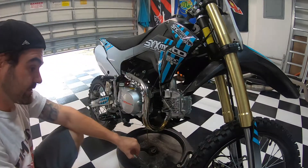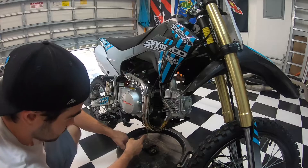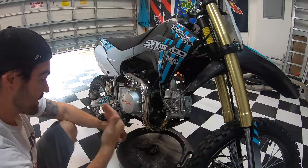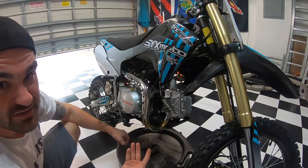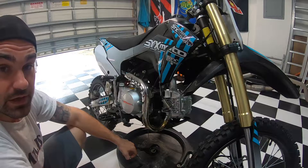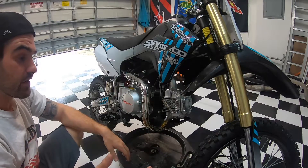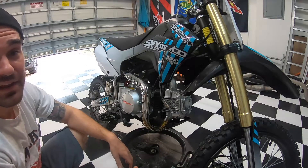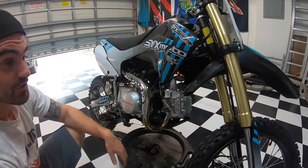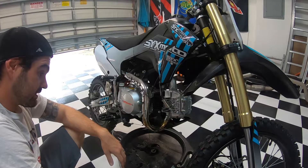There's not going to be a lot of oil in here since it's just the factory shipping oil. You can see it's super thick — it's worn from the break-in and it's cheap oil to begin with. Let that drain, then we can get the new oil in. From my research, you want somewhere between 700 and 800 milliliters; I'm going to split the difference and go with about 750.